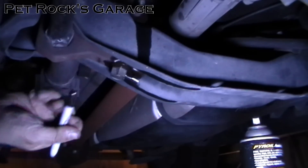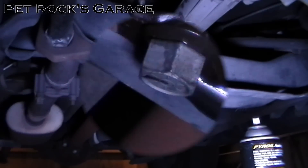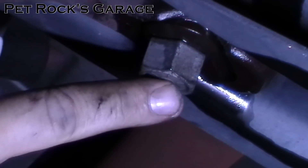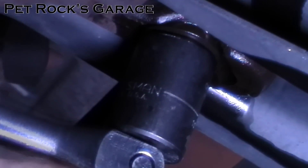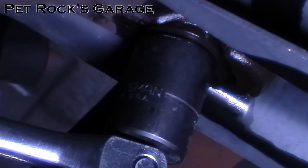Another thing you want to do is take a Sharpie or some other kind of paint pen and mark the bolt. I've already marked mine right here, pointing straight sideways, so that I can keep track of how many times I've turned it around. When you set up your socket on your breaker bar, try to make it so that it matches that line so it's going about the same direction. This will help you keep track of how many times you've turned the screw and adjusted the ride height.